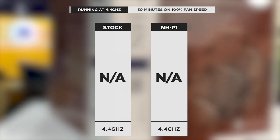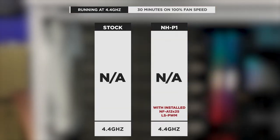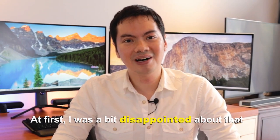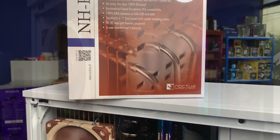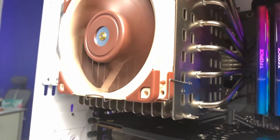We also tried to get an extreme overclock of 4.4GHz, as regular viewers will know. Not all coolers can manage that. The stock cooler can't, and unfortunately the NH-P1 can't either — even with the A12 X25, it could not deliver a stable overclock at 4.4GHz. At first I was a bit disappointed, but to be fair the NH-P1 wasn't designed for anything like that. It's actually impressive that it managed a stable overclock at 4.2GHz, which is already around a 15% performance increase from stock speeds.